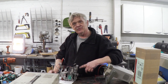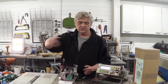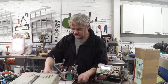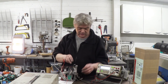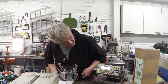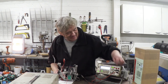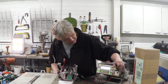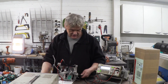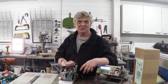If we put that back into series, incidentally, this will actually be a generator. I've reconnected it in series — one end of the field coil going to one of the brushes, that brush going to the meter, and the other end of the field coil going to the meter as well. I've got it set up in amps and if I give that a spin by hand — I get about 15 or 17 milliamps. And if we put that back into volts — about 140 to 170 millivolts. So that is how you use a washing machine motor both as a DC motor and as a generator.